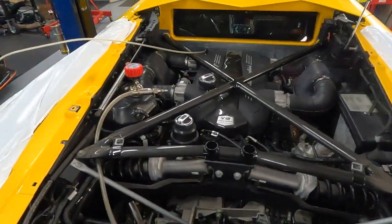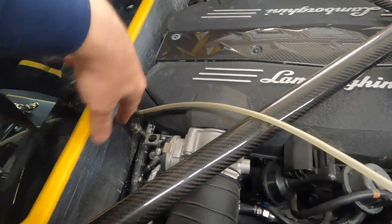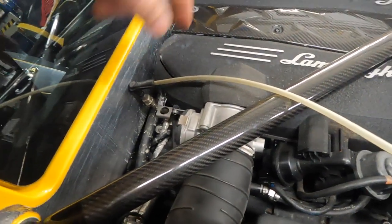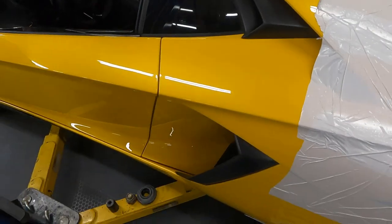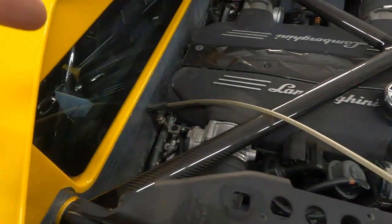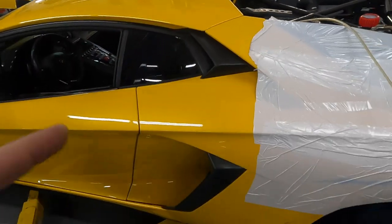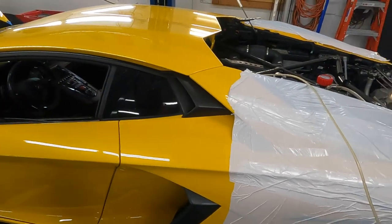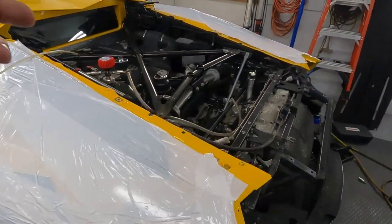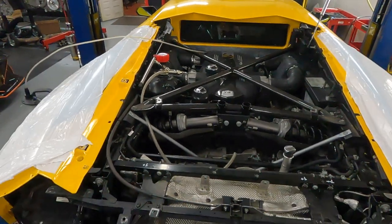Now, here is the clutch bleeder screw right there, between the firewall and engine, close to the intake manifold. We open this valve, it's already opened, and what we need to do is simple: the battery is connected, we open the door, the pump starts pumping, builds the pressure, and after we see the fluid coming, we close the valve, and then we need to fill the reservoir with the fluid. Then we have to calibrate the gears because the system is empty. We have to bleed the gear and shifting unit, and then bleed the clutch again, and then we can fire up and do adaptation.